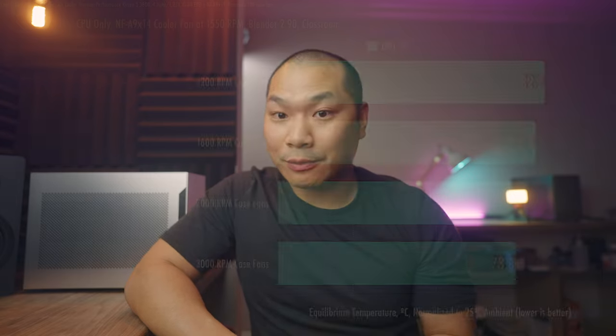You'll notice that I've locked the voltage here, and it's not a bad idea to do that, so long as you can get at least the stock PBO boost clocks — like I've done here — locking this at 4.3 GHz and 1.25 volts. With Ryzen 5000, you can also set a negative offset and curve optimizer and a PPT limit, so that way you can get stock performance with more optimal voltages.